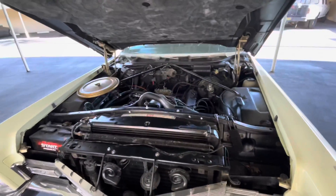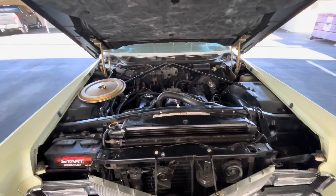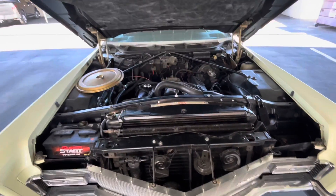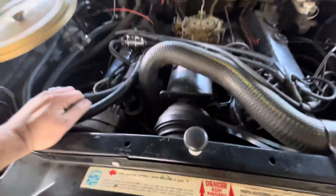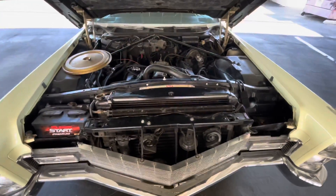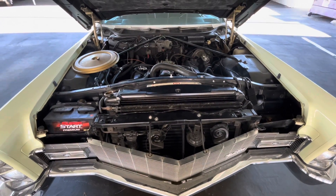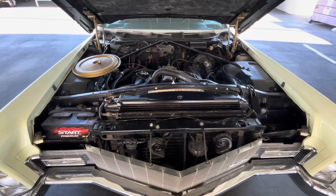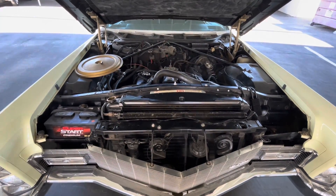Back on Steve's 68 DeVille, it's water pump time. We finally got the right water pump because if you remember last time we went to go put our belts on and they hit the pump because someone put a late pump on. So we'll show you the pump, get all the things apart that we need to get apart. This is going to take a while, and then move, move, move — get her done.